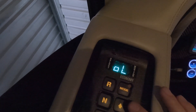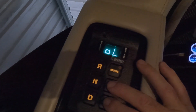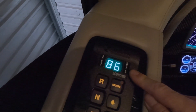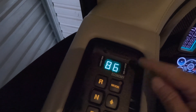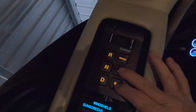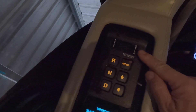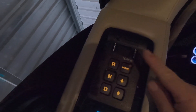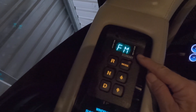To go into the second part of the diagnostic mode, toggle the up and down arrow again at the same time, and you enter the oil monitor life — this reads from 99 down to 0. It's at 86%. The third press will bring you to the filter life monitor, indicated by FM, and it'll tell you OK — or it could tell you that the life is low, which would be L0.